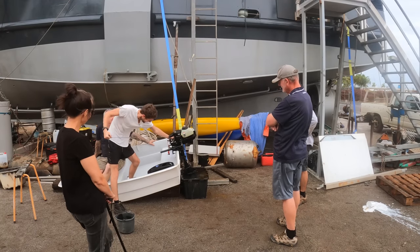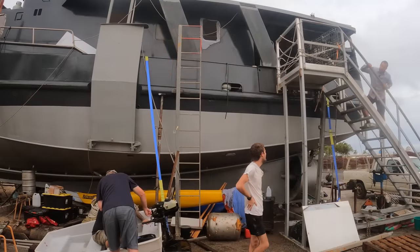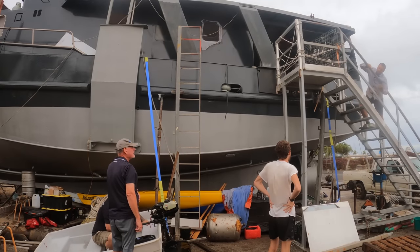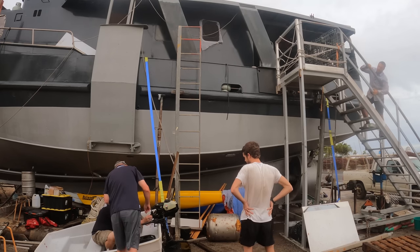Five minutes later. My arm's tired. Should we take the spark? Yeah, probably should check the spark. We may have flooded it. Just pull it over on full throttle with the choke off. Pull it over a couple of times like that. Yep, and you'll clear the cylinder out.